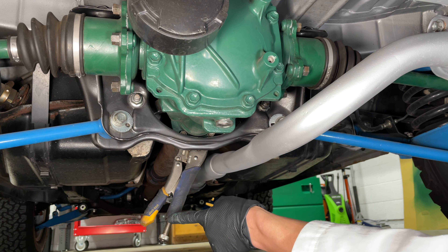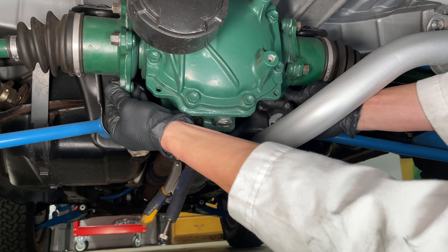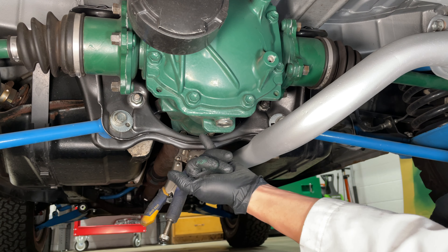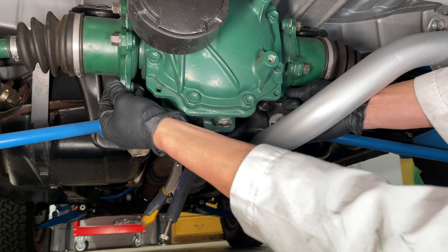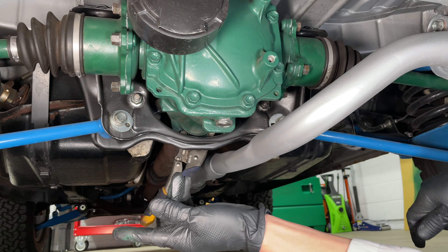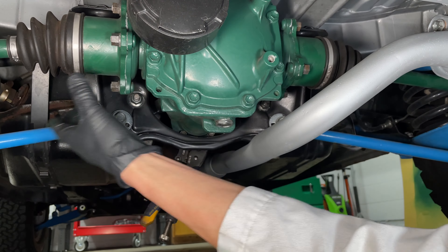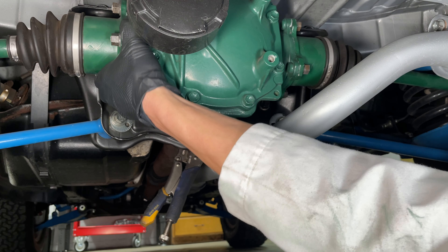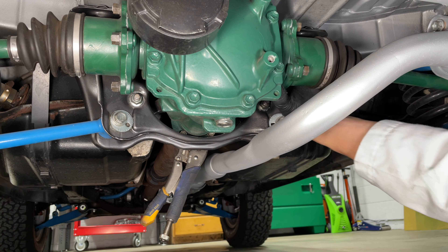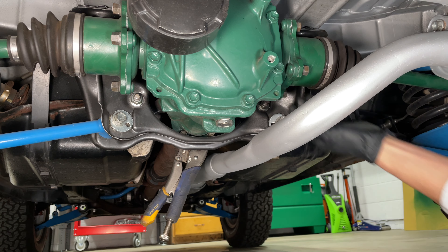Notice we have vice grips indicating the position of the drive shaft. If we turn both the same direction, forward or back, there's almost no play. That's testing for play between the ring gear and the pinion gear — so that's good. If we test opposite directions, there's a little bit of play, meaning the spider gears in the differential have some play. But check this out: the CV axle shaft is not moving, and this part is. There's a lot of play in that inner CV joint, and on that side too. This is sitting still and that's moving — there's a lot of play inside that CV axle.